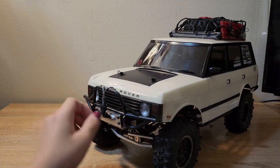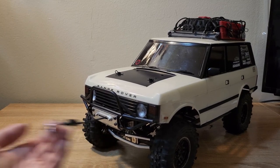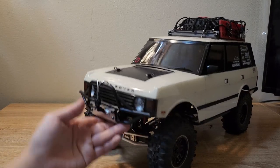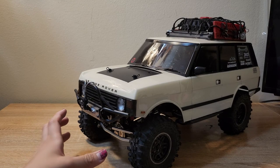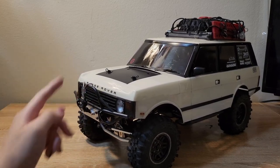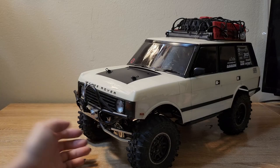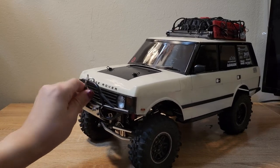I can add D-rings here eventually. You can see this DSM off-road quick-release recovery hook — I'll show that working in a second. That adds to both the performance and the look. I thought it would be nice to put on here because even though this has a fairlead, there's not really a place to mount a winch. This is much easier to use than a winch — you don't have to do the extra wiring, figure out where to put a winch, and since it doesn't use any electronics, you can submerge this thing and it's not going to break.